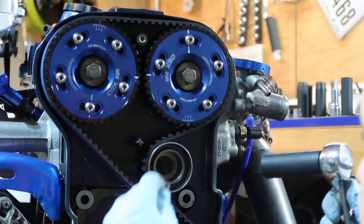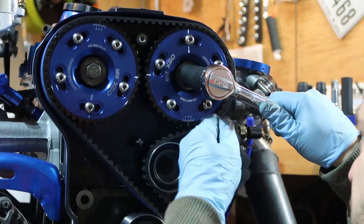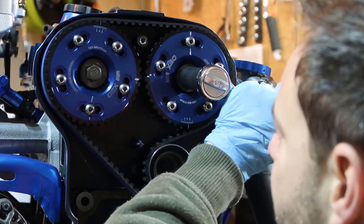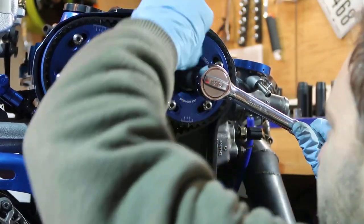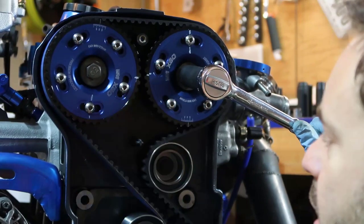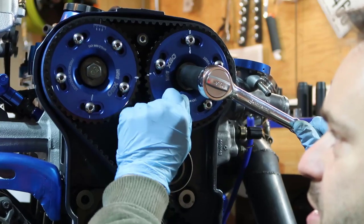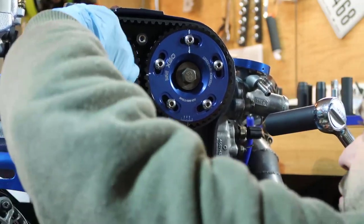And what is going to happen when I loosen this guy here, when I loosen those two, one and two, the other ones are loose already, right, this is going to move. And so I need to move this all the way to where I think the middle is. So I'm going to tighten this one here and probably one on the bottom. Because now we are not moving the teeth anymore, but we are moving the inside. So you can't count on the mark of the teeth, but I left a mark on the teeth so you can tell how many degrees you moved the thing. So now I'm going to loosen them.